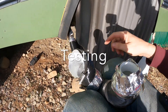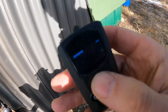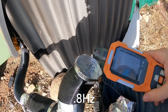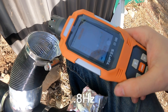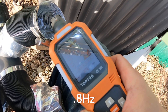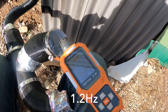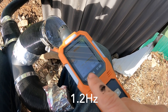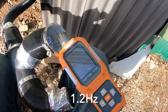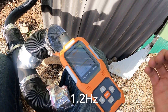I added a little tailpipe extension — we're going to be sticking the sniffer in one of these, and you're also going to need your adjustable remote for your heater. Right now we're running at 0.8 hertz. You can see I'm getting around 230 to 240 parts per million — that is soot generation, that's really not running very well. After running at 1.2 hertz for a little while, look at that — we're right around 50 ppm. That's a huge difference from the 300 before. So even though I followed the recommended settings for my altitude, if I were to run it at that lowest setting it would coke up really soon.